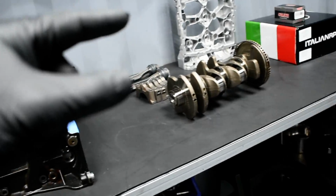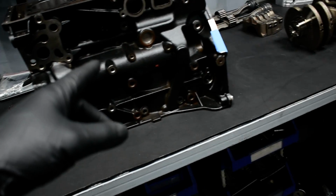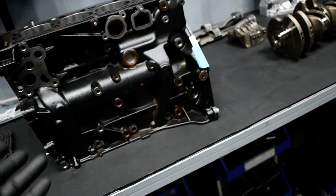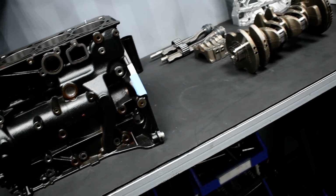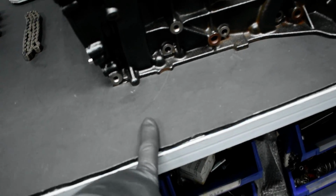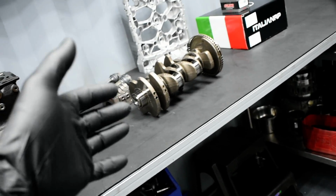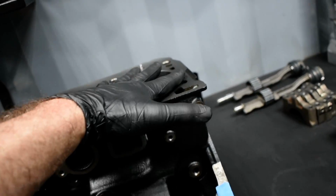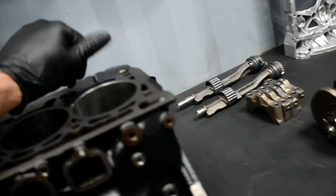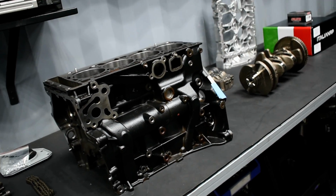Like I said yesterday, piston, connecting rod, crankshaft, bearings. Flip the engine. I don't have an engine stand because all 10 engine stands are full. So I'm gonna make it on the rubber table here. I have no choice. Checking the clearance. Before I check the clearance with the plastic gauge, I want, like I said, to bring in the top dead center to see how much out it's coming the piston. Let's do that and then the rest. We are starting from there.